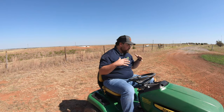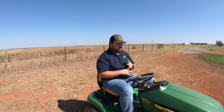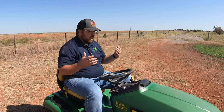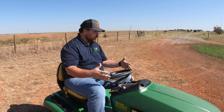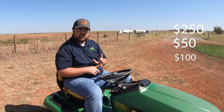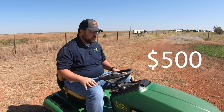I am super happy right now — we are fully functioning. The mower deck is working, the engine is running good, it's got fresh oil, fresh filters, and that new ECM which seemed to fix all of our problems. I also changed out that carburetor solenoid just to make sure. We paid $250 for the mower. I added a home maintenance kit at around $50, the new ECM at $100, and the new carburetor solenoid at around $90 — so we are in this mower for only $500. This was an absolute steal.